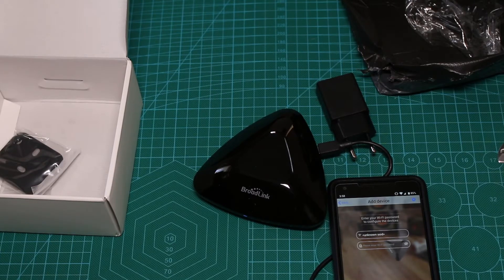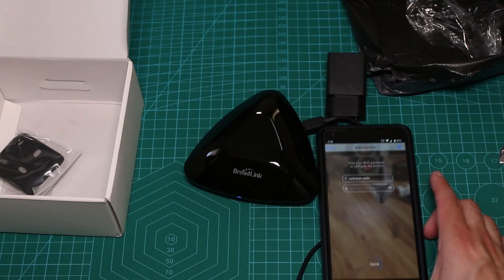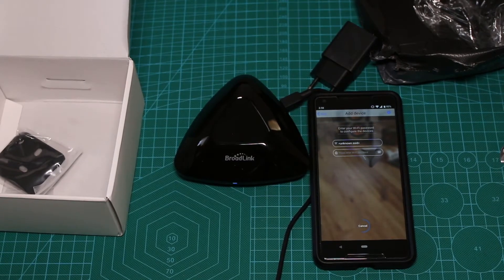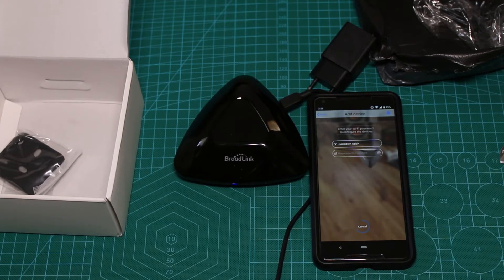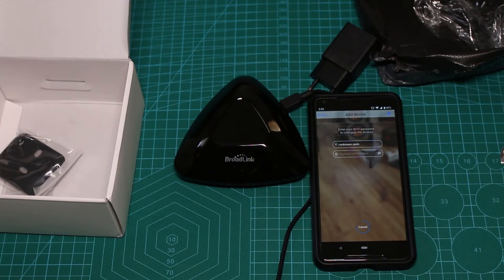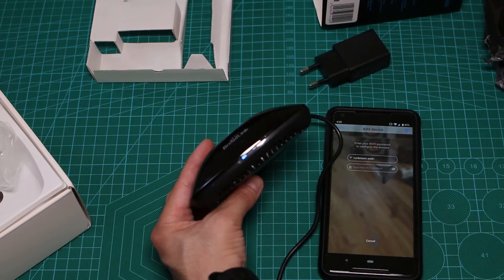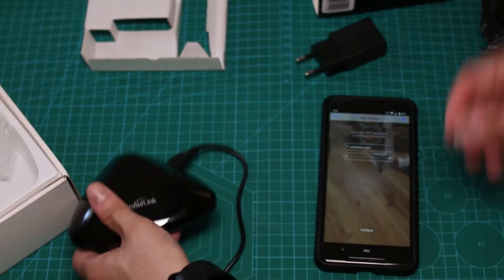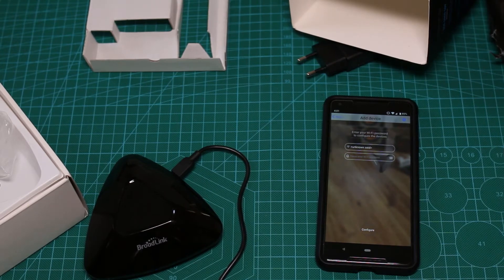I'm pretty sure it would ask me for Bluetooth if it worked with Bluetooth, but it doesn't seem to ask me for anything. So I just pressed configure and the process started. The device is still blinking but I noticed it's blinking slow now, so I think it's trying to connect. Since I have a MAC filter in protection it will not be able to connect as usual, so we will have to edit that somehow. Maybe I need to set my Wi-Fi connection manually on the phone or something. Okay, so it failed again. There's a serial number on it but do we have its MAC address anywhere? Okay, I'll have to find its MAC address, add it to my router, and then we'll continue.